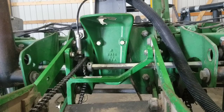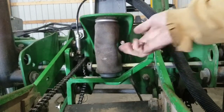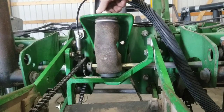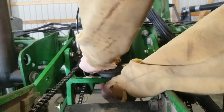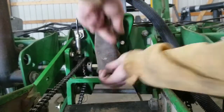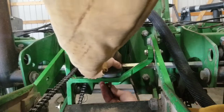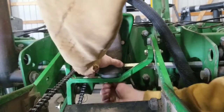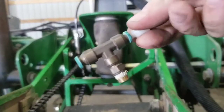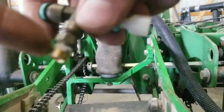The last thing here — about the easiest thing — is we have to take the air spring and put it in there. It's got a lock nut for the top and a bolt that threads in through the bottom. Then we have to put this back on top — this is our fitting. Before I go to plumb it up, I'll take and put some thread tape on that, seal it good and tight.